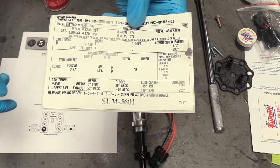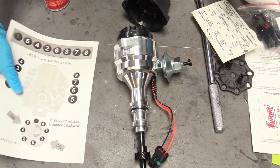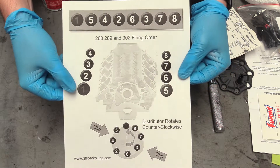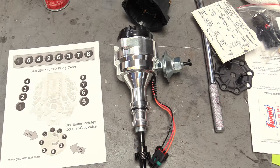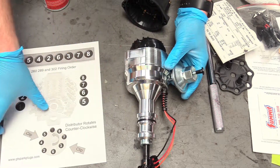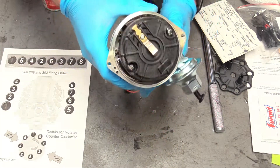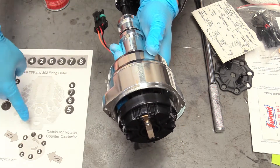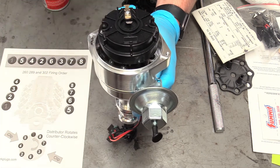If you put a new camshaft in, you have a cheat sheet — look, it has our firing order right there: 1-5-4. So it's going to be using the older firing order, which I'm super okay with. I have a handy sheet linked down below in the description showing exactly how the firing order goes and which cylinders are where. When installing a distributor, you have to figure out how it's going to be oriented in the engine. Our sheet says that number one points straight back. So you have to figure out where number one is — right here where I've made this golden mark. Basically, if you're looking straight at the engine, number one is straight backward, so the vacuum advance is going to point straight forward.